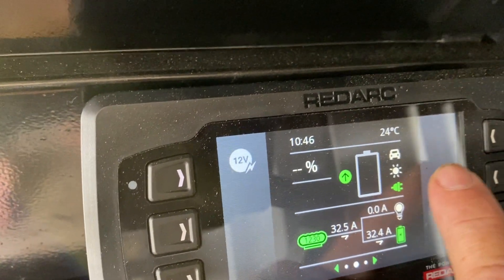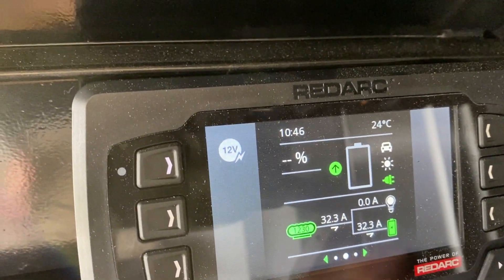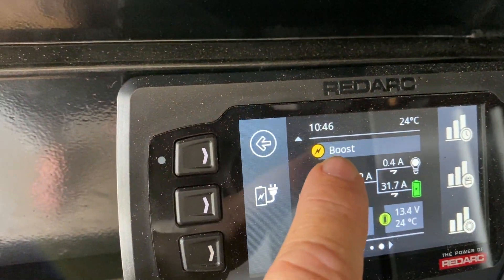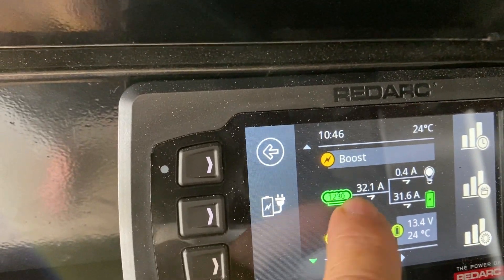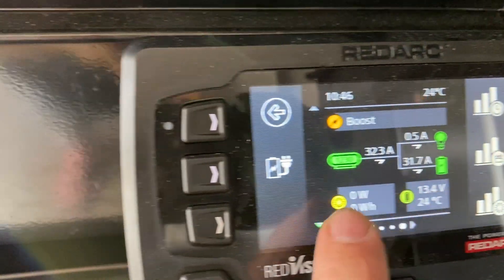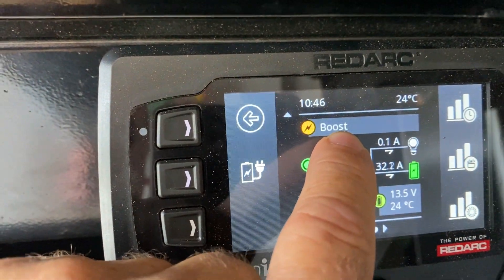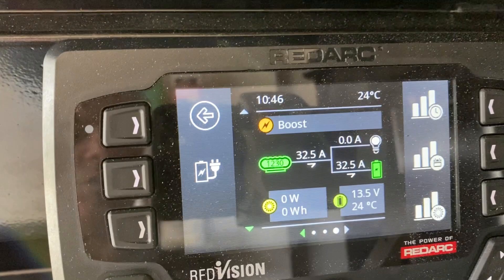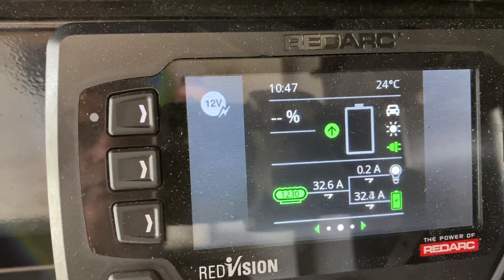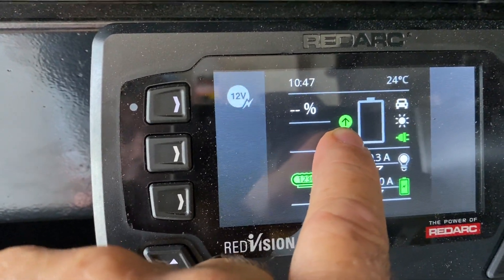As you can see, I've connected up the shore power - that's gone green. This is what's coming out of the battery charger, this is what's going into the batteries, and that's what's being drawn out of the system. Currently we're on boost with the battery charger. You can see what amperage is going into the batteries and what's being drawn. This is the battery temperature and the current watts of the battery. This is our solar feed in - because we're in the garage, we've got nothing at the moment. This boost setting will change depending on what the charge is doing, so once it gets to charge it will go to float. This percentage will come up in a moment with regards to where the battery is - as you can see we're feeding into the battery at the moment.